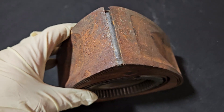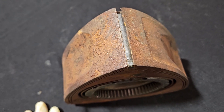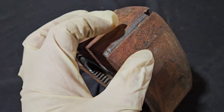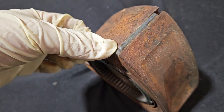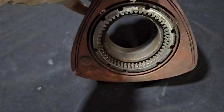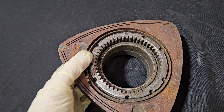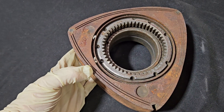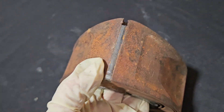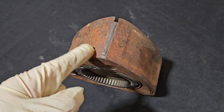This is why Mazda in general, when you talk RX-7 to any car enthusiast out there, they think they have to say something about the apex seal. This is a carbon-based apex seal, and they did not have a long lifespan. Mazda was still working on the sealing, wearability, and overall construction of their components. How the stationary gears are put in with roll pins, down to one side seal, corner seals — everything was in development. The technology wasn't quite refined, and these early apex seals actually did have a very short lifespan.